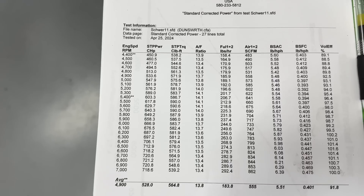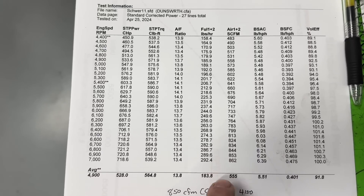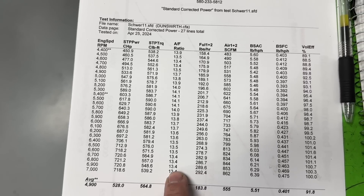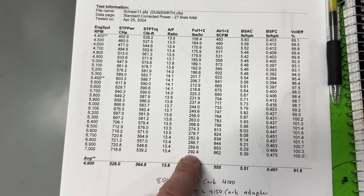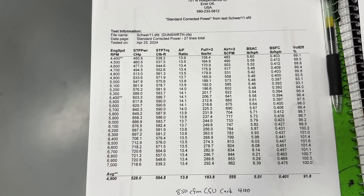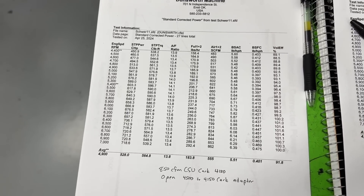What it's doing is using an air turbine that spins to measure airflow — you can see 862 CFM out of an 850 carburetor, telling you it's pulling more than the carb can handle. Then it takes the amount of fuel that went through and calculates the air-fuel ratio. I think the fuel meter is wrong, because 14s sounds way off. I don't doubt it was lean, I just don't think it was that lean. We could have jetted up, but this was just a dyno carb, not the one he's going to run, so we put on the Dominator he was going to use anyway.